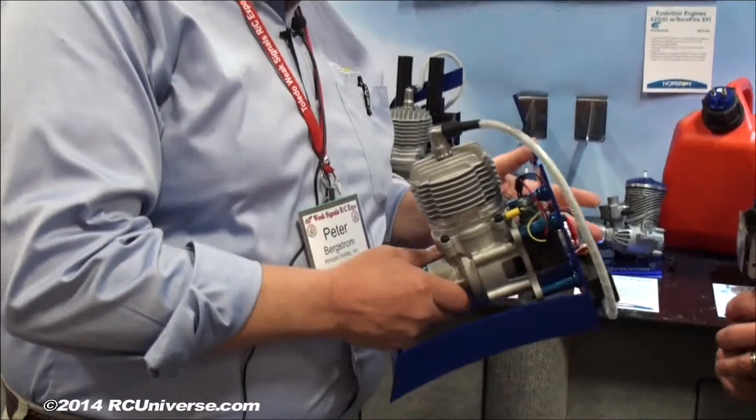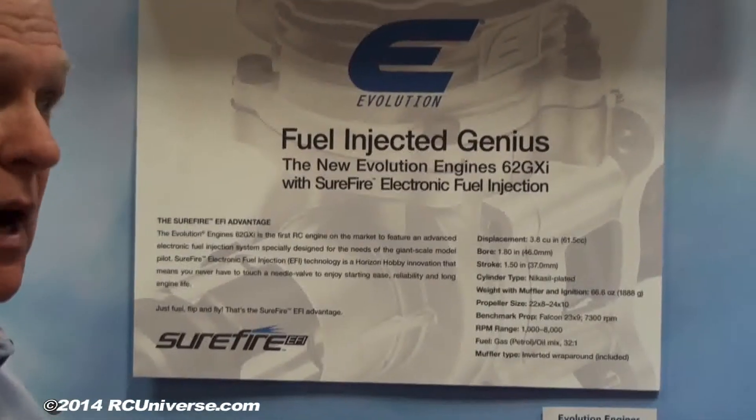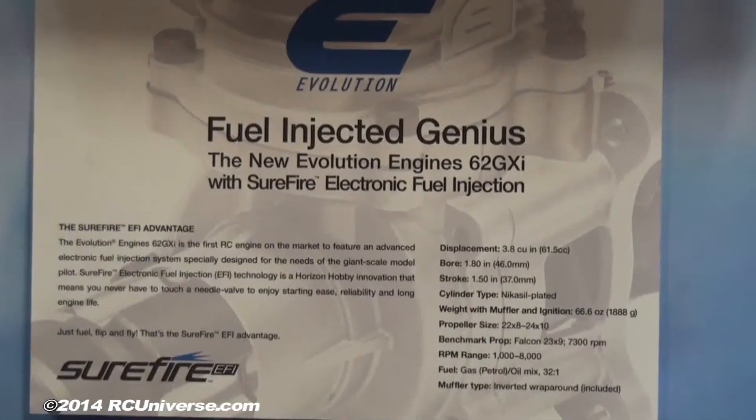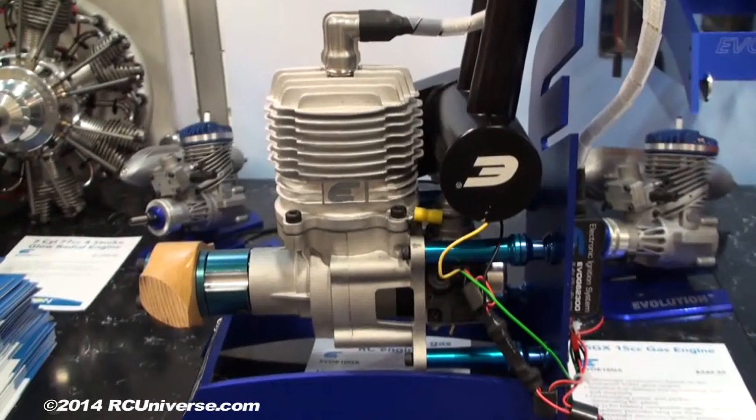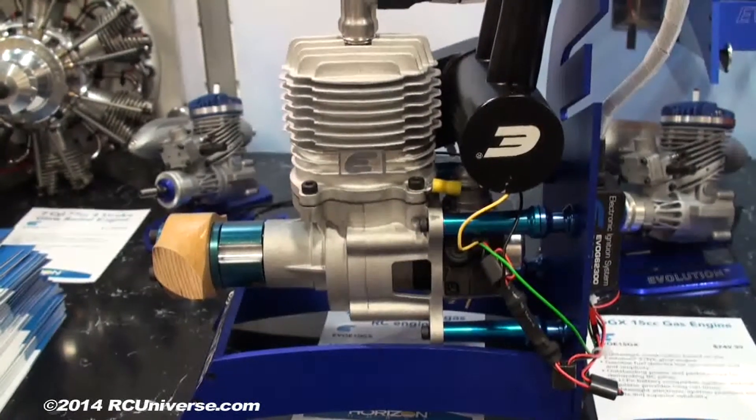So what's the point of doing EFI? The point is to make it easier to operate. Wait — it's not for more power? No, that's a pretty common misconception about EFI. Most people think of EFI as being a more powerful option over a carburetor, but in reality an engine produces only so much power. With an EFI or carburetor you're just controlling how much fuel goes in — not necessarily making the engine more powerful. The power is in the design, the internals, timing. A carburetor or EFI controls the engine. What we wanted was to make it easier to operate — like how we just get in our car, push a button or twist the key and it starts. No more choke, no three pumps on the accelerator.